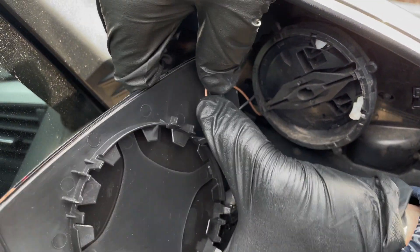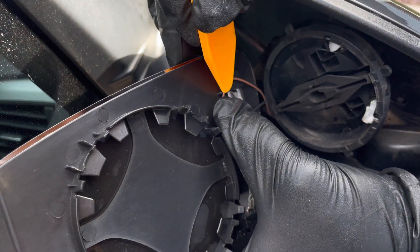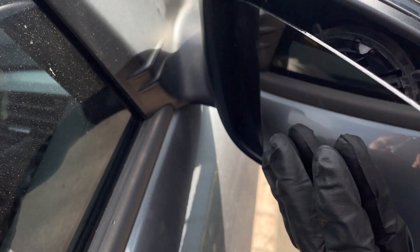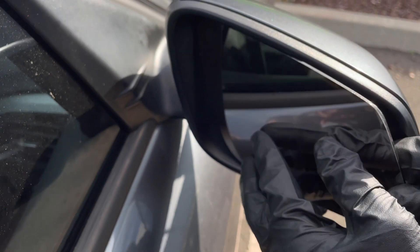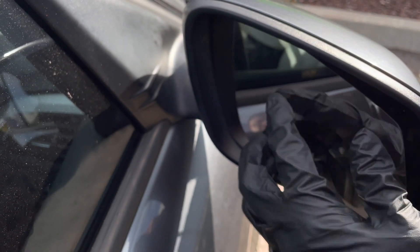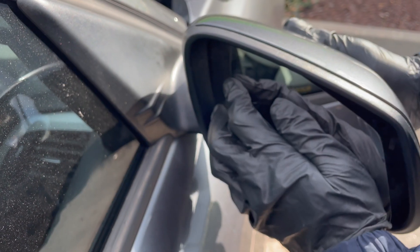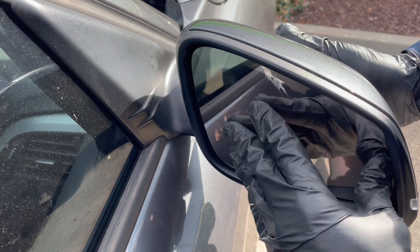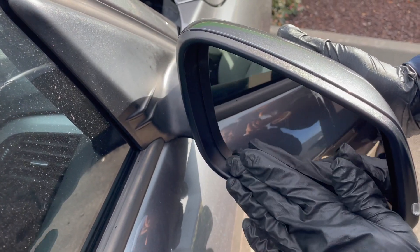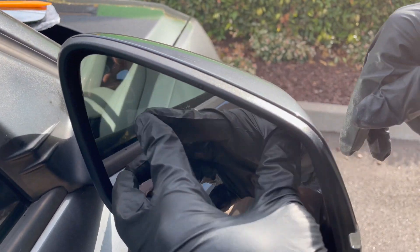Connect the wires back into the little wire holders like so. You might need a pick tool for this or a plastic pry tool. I'm going to clip the mirror back onto the frame, so just make sure you've got it in the right way. Be nice and gentle with it — lock in one side, and then just snap it back into the frame like so. And that's the glass replaced.